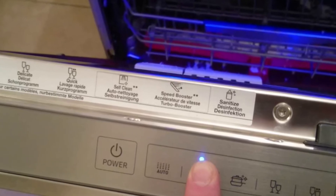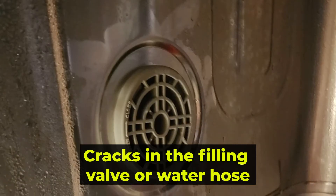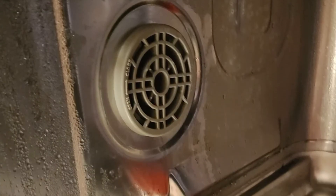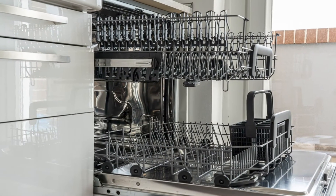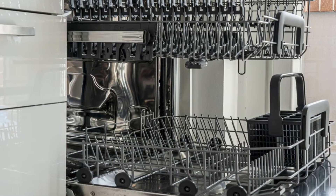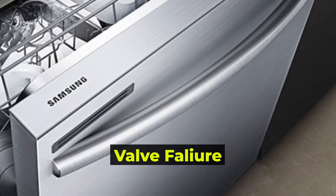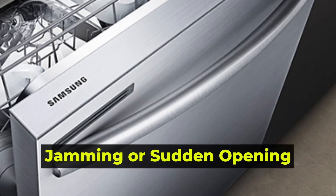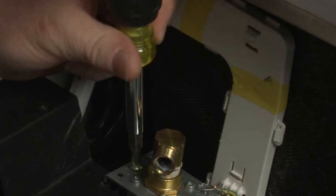The following are some of the common causes of the LC error. Cracks in the filling valve or water hose — this is a common occurrence when you spot the LC error in a Samsung dishwasher, because water seeps out of the hose and into the lower tray. If it's a major problem and you see a puddle of water, this could also indicate a valve failure, such as jamming or sudden opening. The valves control the water level, so this is important to observe.